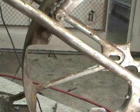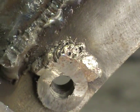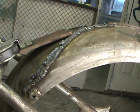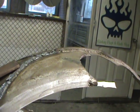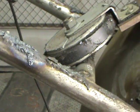It's all good. Gonna grind that stuff down. Anybody who's done body work — when you're grinding, you want to use some air to cool the shit down, because you don't want to get all done and find out it's warped. I've been there more than once.